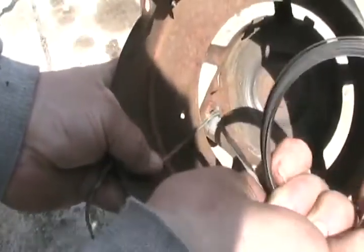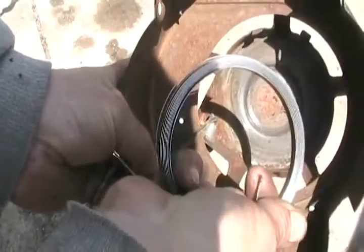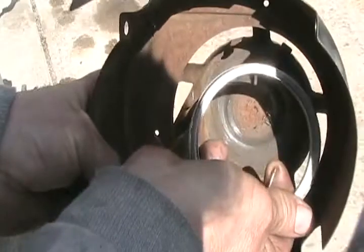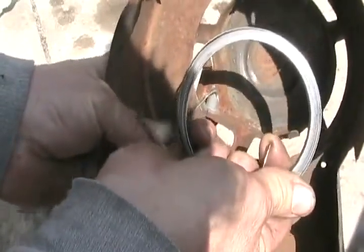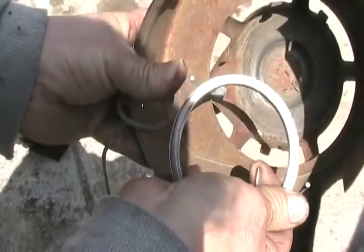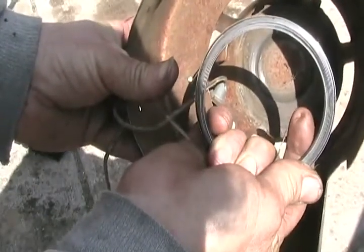The little notched area goes in the hole in the cover — that end goes in there just like that. Stick it in sideways and twist it. Carefully set the spring in the pocket. When it's all the way placed in there and hooked in the hole, release it while keeping your thumbs pressing it down so it doesn't jump out. Then when you release it, it'll stay there and won't unwind anymore.